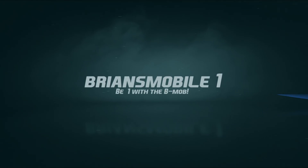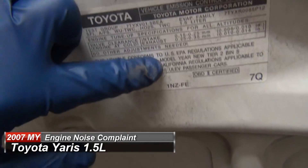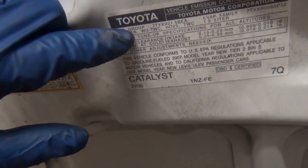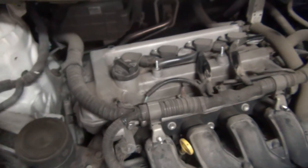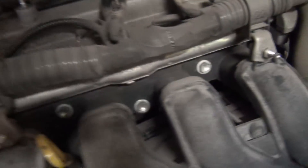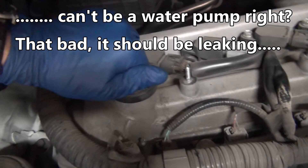Ryan's Mobile One. We're working on a 2007 Toyota Yaris. You can always tell the year of your car if you just look at the little emissions tag — it'll give you both the engine size. This one's a 1.5. It'll say like test group or something, and then what model year it complies to emission standards for. As you can tell, this one's making kind of a noise, and it sounds like it's coming from where the timing chain is to me. It might be from the alternator, but I really don't think so. It sounds like it's right in here. It could be valve train — I don't know.